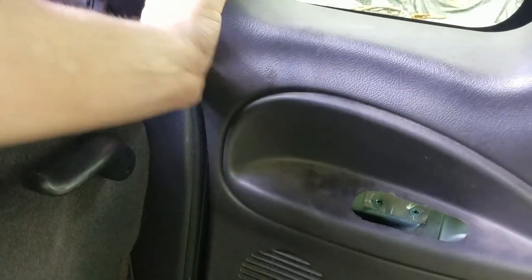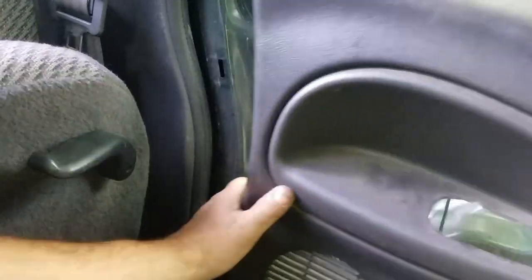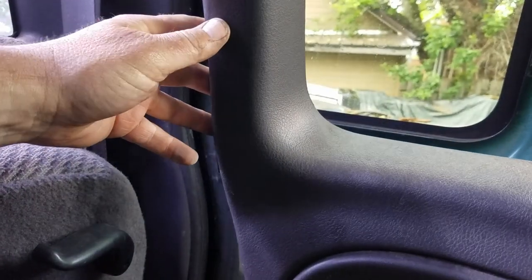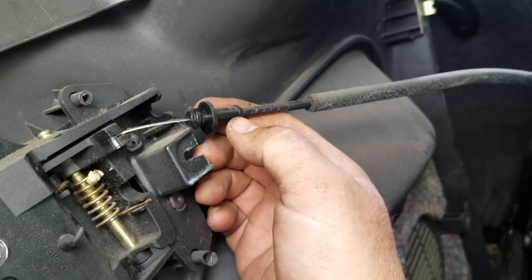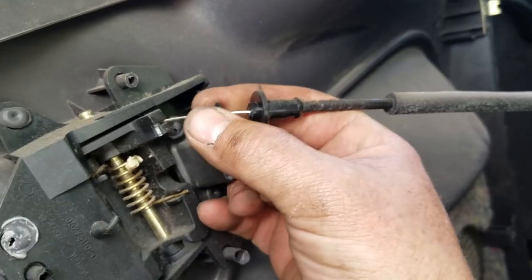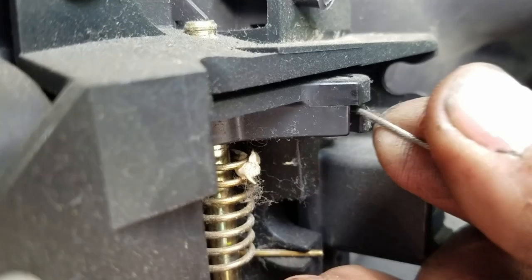We've got most of them, just a couple more. There we go. Go ahead and take the door skin off. There's a cable back here — let me show you that. Here's the back side of the door handle and door skin. Apparently this broke — maybe I'll try to super glue that. This sticks in here; just pull this out and bring it around like a bicycle brake cable, reach that slot, and it just pops right out. Then you can take your entire door panel out and set it to the side.